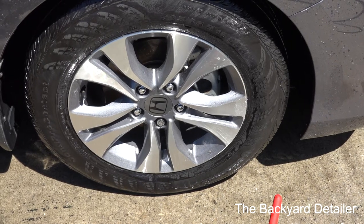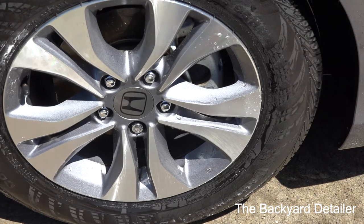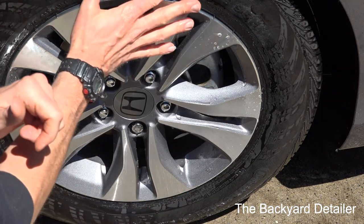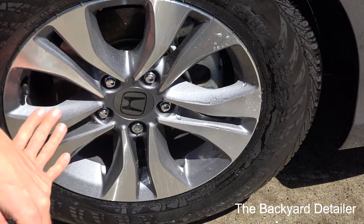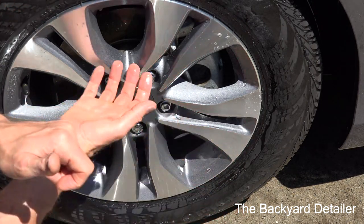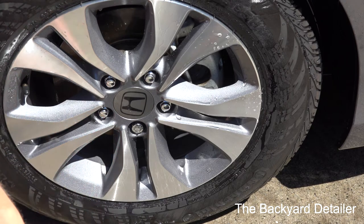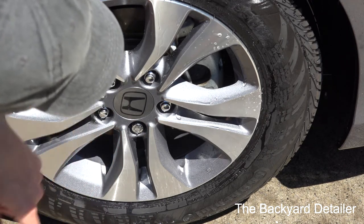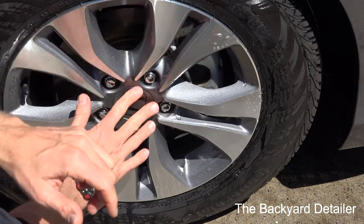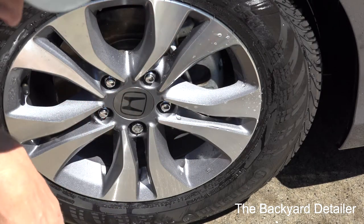That wheel is perfectly clean and the tire is perfectly clean — there's nothing on here whatsoever. I've gotten everything clean without hurting the paint sealant, and I've removed any caustic material from the brake dust and road film off the barrel of the wheel so it's not going to etch or damage it. That's how you do aluminum alloy, painted aluminum, and brushed aluminum — this one is actually partially brushed and partially painted with a clear coat inside. Next I'll show you how to do a chrome wheel.